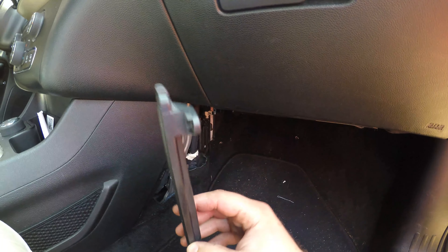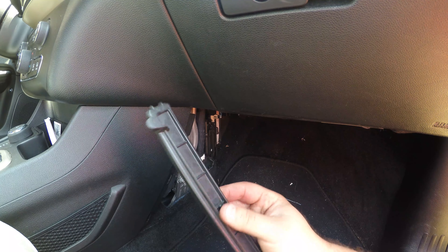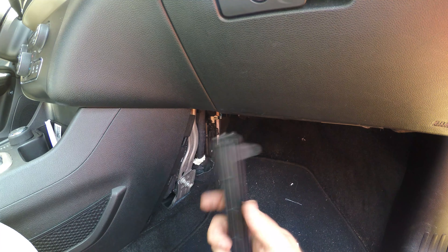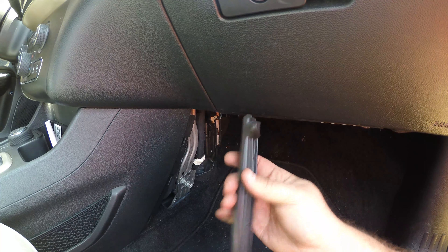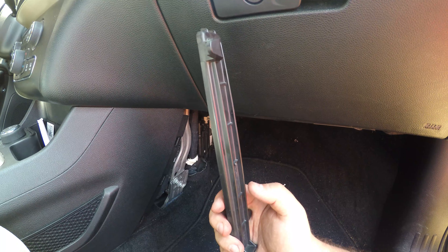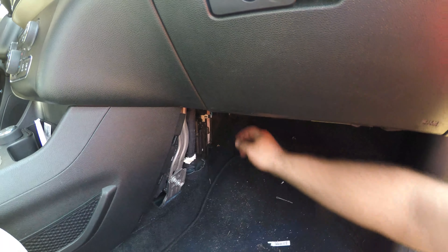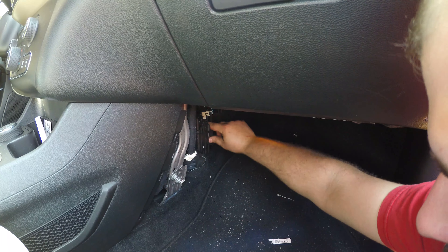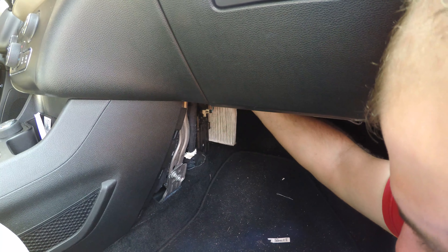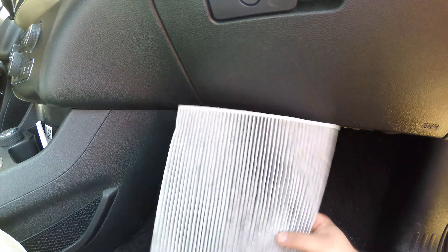You can see it sits in there. I actually noticed the top tab is busted — that's not something I busted. I'm actually going to think about getting another door for this. Note there is an airflow arrow, and it's pointed back towards the passengers of the car — that's how we have to put the filter in. Now let's get the old filter out, which is easier said than done sometimes with all this other stuff in the way. There we go. Yeah, that filter is definitely dirty.